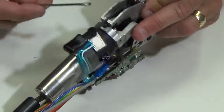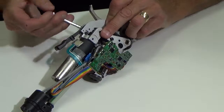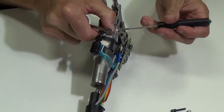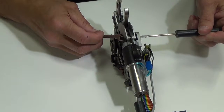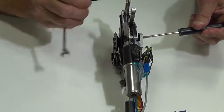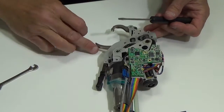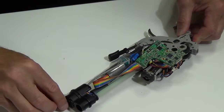There is a screw on this side, so you may have to put a medium blade or small bladed screwdriver in the slot here. I have a small bladed screwdriver in the slot on one side of the screw head, and then I'm just using this open end wrench to take off the 5.5mm nut and washer that are underneath there. So I've removed them.